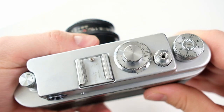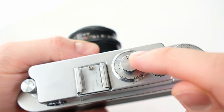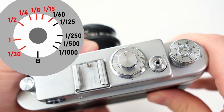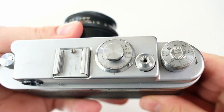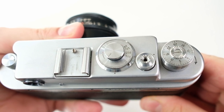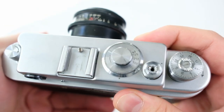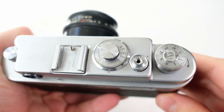On this camera you can probably only see speeds from 1/1000 to 1/60, because the red text showing the other shutter speeds has faded away — that's a common problem with this model. For bulb mode without a remote release, there's a useful feature: press down the shutter and rotate it and it will stay pressed in. Rotate it again and it releases back up.